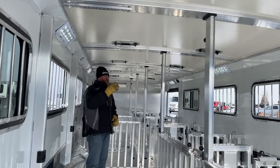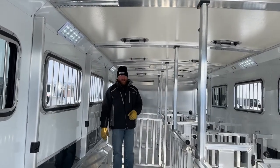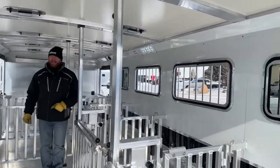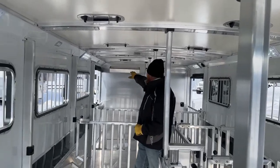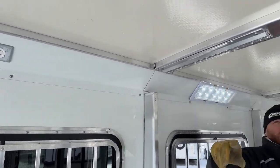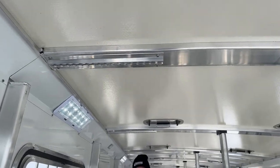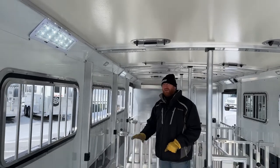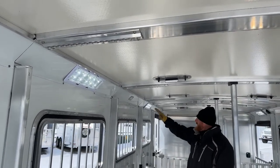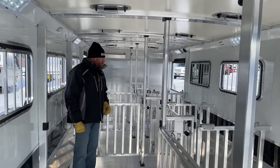We have two-way roof vents to manipulate airflow. We have drop windows, lower air gaps, an insulated roof, and two-way roof vents — making a massive difference in how we can actually control this temperature. We actually have some outlets in the top rail — one over here on the passenger side, and three over here on the driver side: one in the front, one in the middle, one towards the rear. We've got airliner track off the roof bow, so we can get some inserts, connect them in there, and actually hang some fans or heaters. That's an aftermarket piece, but to have that to hang fans and help with airflow makes a big difference for general temperature control back here. That's where that 30-amp breaker and that portable generator bracket come into play — really well set up as far as this actual stall itself.